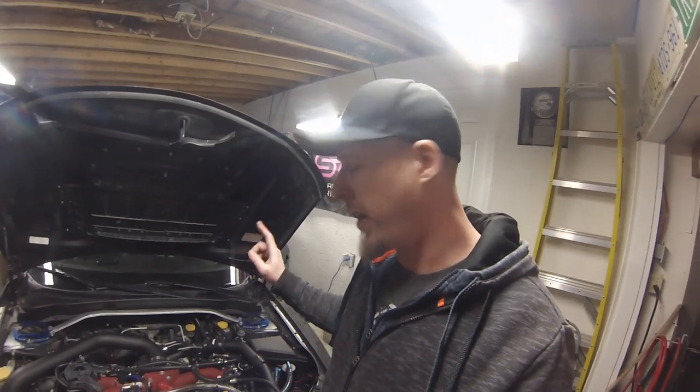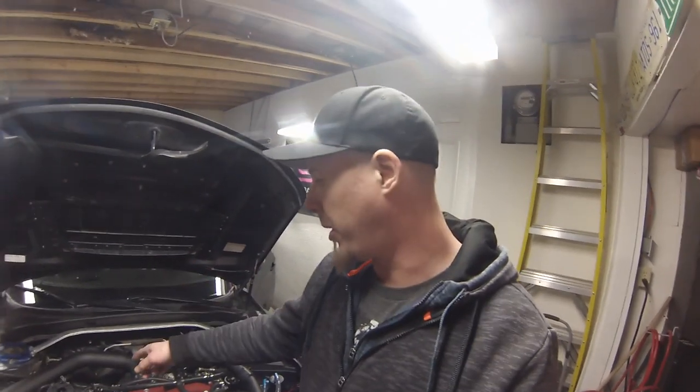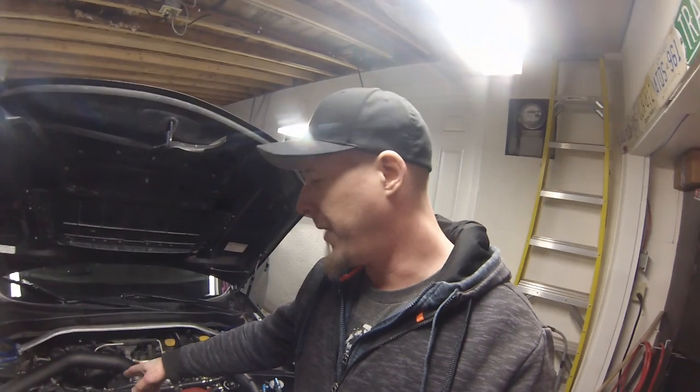So finally, I've got to wire the gauges to ignition power, and once that's finished, Tyler will probably show up by then. We're going to get ready to put the tune into the car. Turn the key. So I've got the gauges all wired to ignition power. Tyler showed up. We ended up going to the parts store and got that vacuum line. But we needed to put in a little adapter because the port on the wastegate is so much larger than the port on the boost controller.